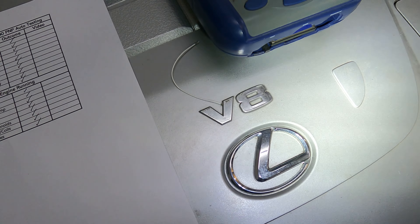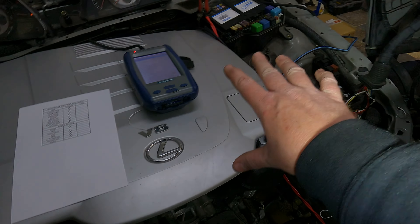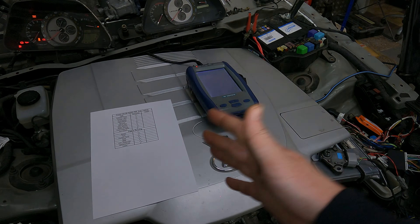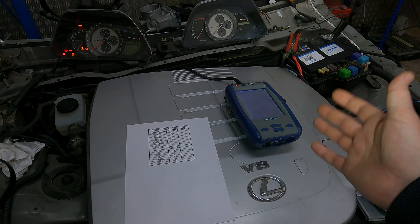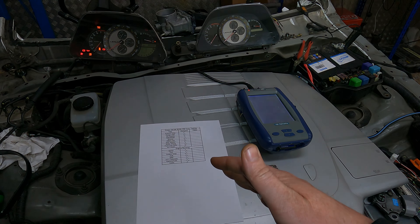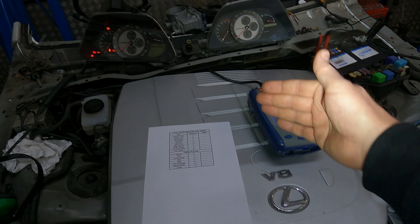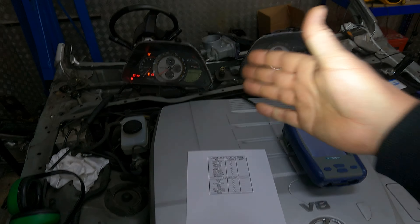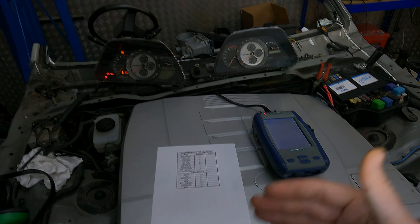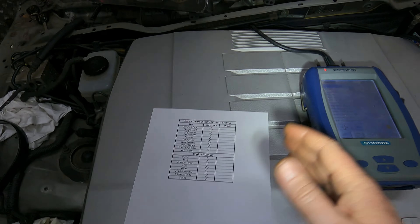Back to park. This will all just plug in — you can put it into drive and go over to sports mode. Until you wire in shift up/shift down and fit a different steering wheel, you're just going to use park, reverse, neutral, and drive. Once in sports mode it'll put the gearbox in a gear and stick there unless you can shift up or down.